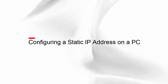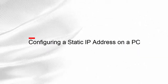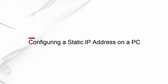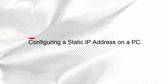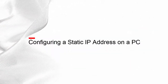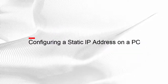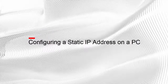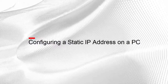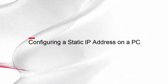Now that we understand that a static IP connection is the only way to establish stable communication between machines, we must see how to establish communication between a computer and a machine via Ethernet. We must first be able to locate the computer's existing IP address in the event it must be reconfigured. You can find it in one of two ways: via the Ethernet adapter IP version 4 settings page located within the Network and Internet Settings at the base toolbar of the Windows desktop, or via the Command Prompt app located in the Windows System folder — just type ipconfig to see the computer's IP address.